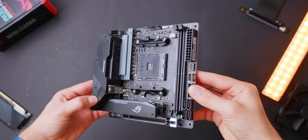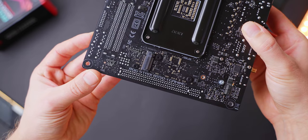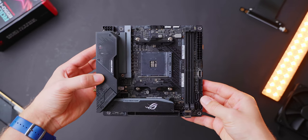Just to give you an example, motherboard manufacturers had to upgrade their PCB designs in a big way to match the full speed of the PCIe Gen 4 interface. That's why only a handful of X470 and the older B450 motherboards actually support Gen 4, while the rest couldn't fully meet that Gen 4 spec. It probably explains why the X570 and B550 motherboards are slightly more expensive, because they have the appropriate traces and hardware to support that whole Gen 4 spec.